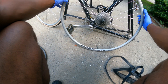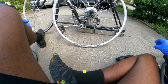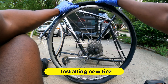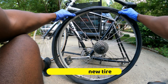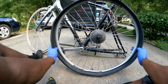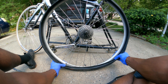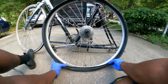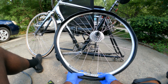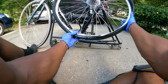The easiest way I found to do this part is to first seat the tire and then tuck the tube in, so let's seat the tire first. What I'm doing is lining up the back side of the tire so it can pop out the rim. I'm just working my way around the sides until I get to the bottom, and then the bottom is going to pop right over the lip — boom. Now that that's in, I want to seat the tube.